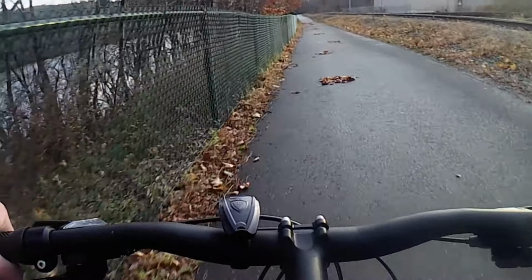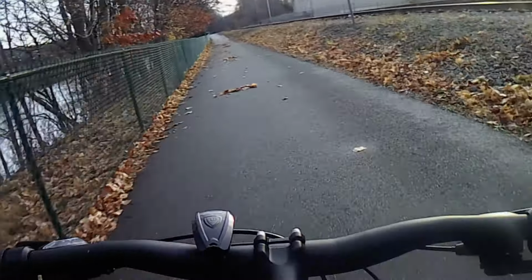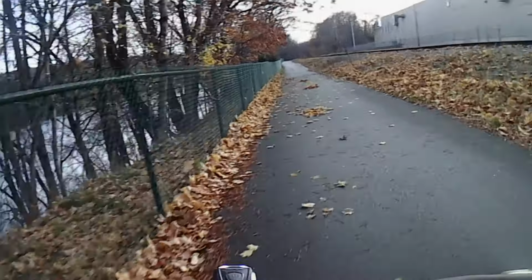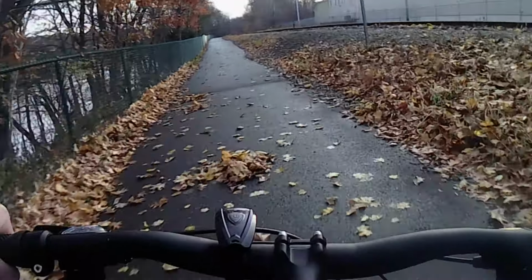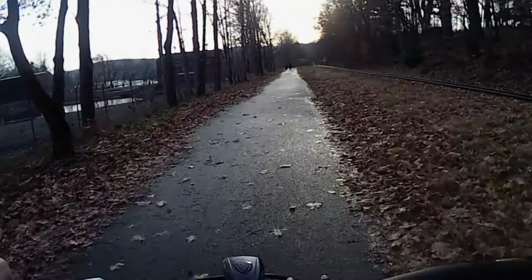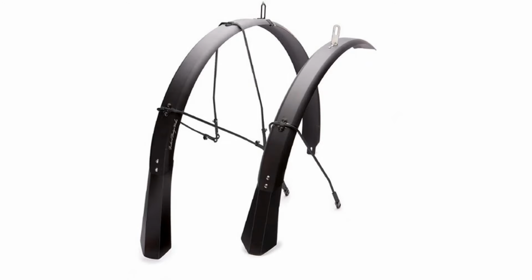So, here is my general plan for this bike. For around $10 to $15, I can convert the bolt-on rear axle to a quick release. And why Schwinn didn't do that for $10, I don't know. To address the slush and the other road mess, I'm going to install actual honest-to-goodness fenders, probably a set designed for a 650B gravel bike.